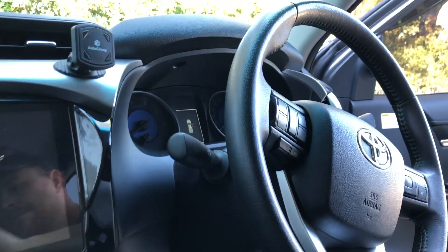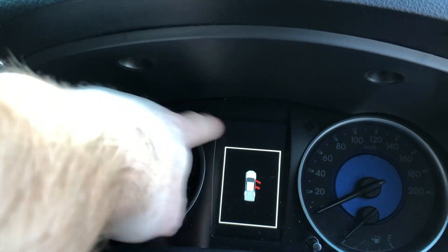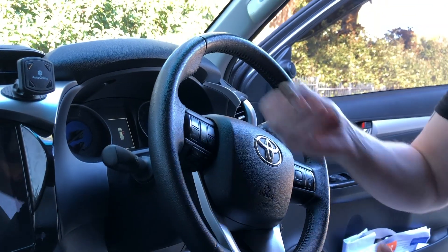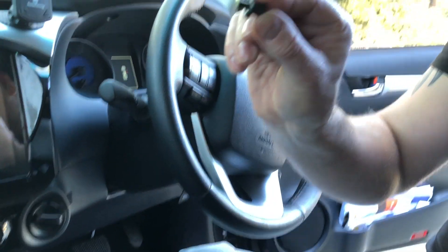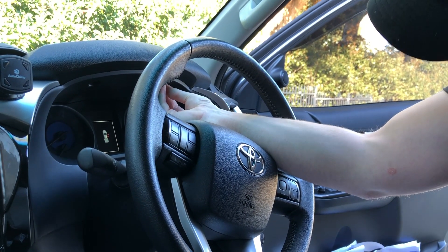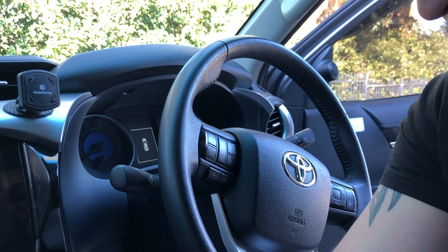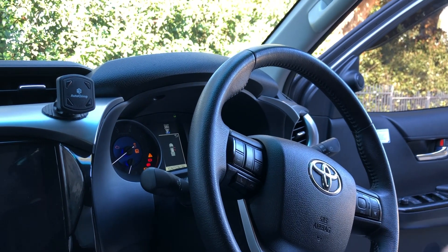If you don't get it right, you'll notice it at the speedo — a little bit of silver will be covered or it'll sit a bit low. Just pull it back out, push it back in again, and make sure you get it right. It is a little bit fiddly. To put the scrivets back in, sit them in a little bit protruded, push them in, spin them until they go in, then push the center in and they'll clip up and in. That is literally the installation done.